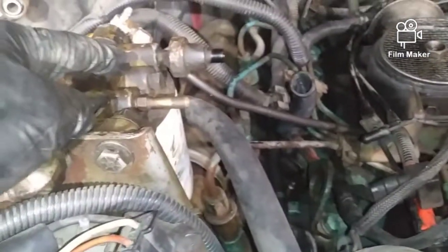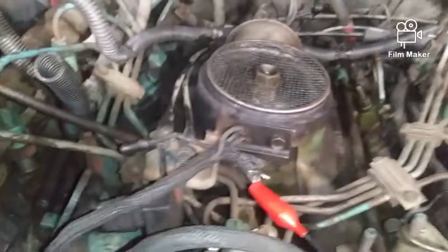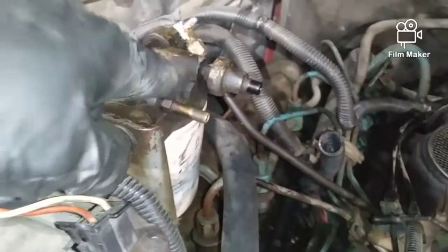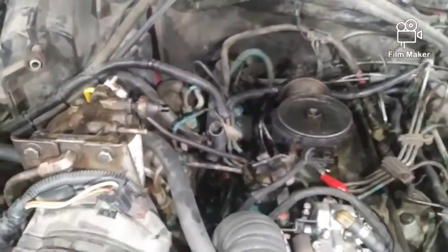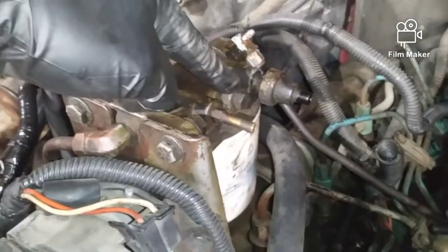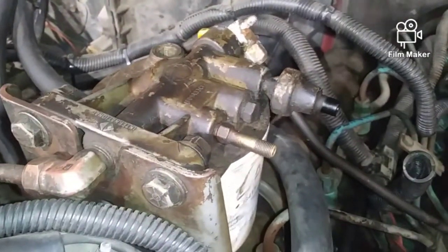Secondly, this is here if you have any fuel that's trapped in your rails up here or in the pump. If you put it through here, some magic happens in the system. I'm not going to get into it. It gets really complicated, so I'm going to keep it simple. It gets rid of the fuel and it recirculates and it pushes the air. Don't ask me how it does it. It just does it. That's what the manufacturer says. And it pushes that air back to the tank. So for this to be capped off is a really bad mistake. I don't know why somebody would have capped it off. Those are the 2 reasons you're supposed to have this thing hooked up. So I will be hooking this back up to recirculate as it's designed.